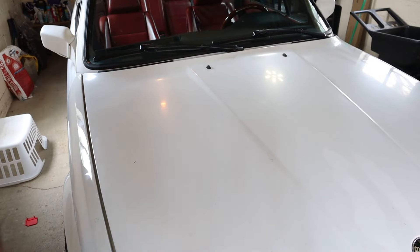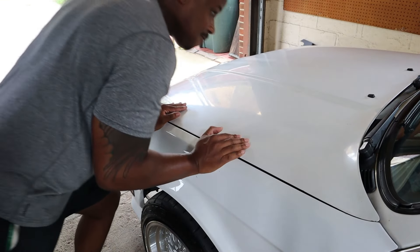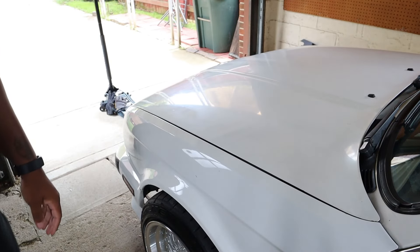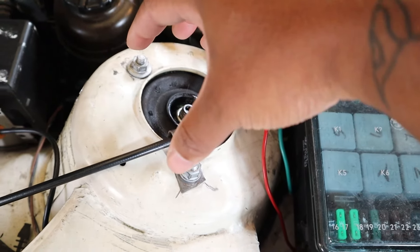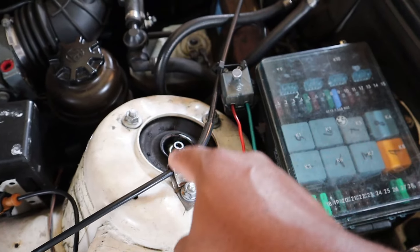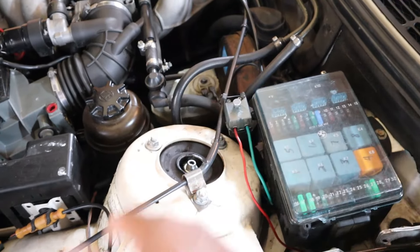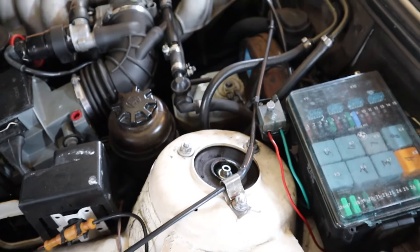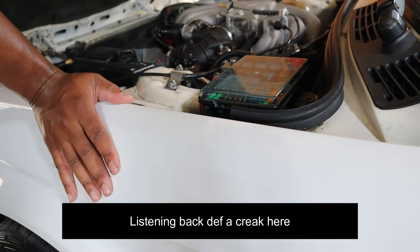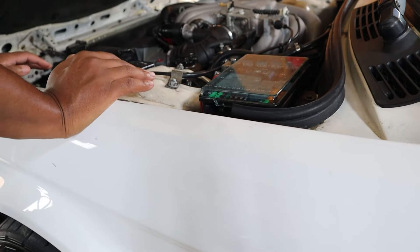I got a little bit more noise on this side. With the hood popped, I want to show you guys this is where the strut tower mount is — this is where your shock absorbers and everything mount to. A lot of times this is actually the source of the noise, but those usually last a really long time. Unfortunately you have to pull everything out of the suspension to get to it. Let's set up on the tripod and shake it — a little squeaking, a little squeaking. Let's try the other side.